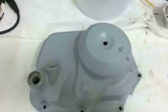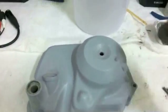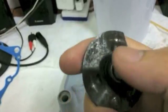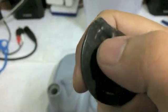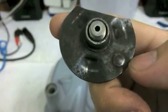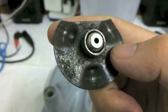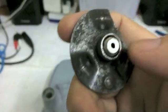First, what I'm going to talk about is the adjuster itself, the semi-automatic clutch adjuster. And that is this bit right here. Now, if you're going to install it, there are 3 components to it. The way to inspect it, this isn't a very clean one, I'm sorry, it's the only one I have lying around, is the area you're going to inspect are these right here, these grooves. You can see there's wear marks on this one, and this particular one is over 40 years old, believe it or not. This is out of one of the very first C50s that had one of the very first modern type of engine, so that's why it looks really old. The center part is new.